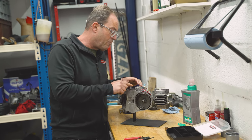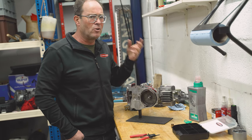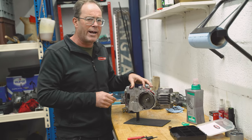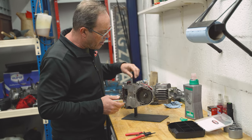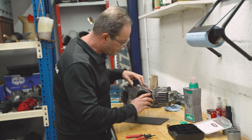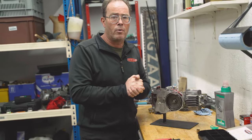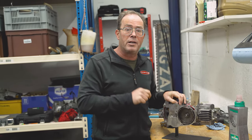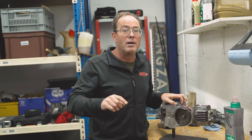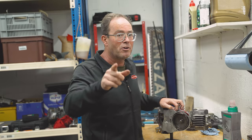We always need to check the internal big sprocket and the little sprocket on the clutch bell. If they are damaged, it won't cause engine damage, but it will make a very high-pitched whining noise — and that's not what you want after rebuilding your engine. If they are damaged, you need to replace the bell and the big sprocket. That's it guys — it's perfect. If you have comments, write them below or email info@pushup.de, and please subscribe and hit the bell for new videos. Thank you very much, bye bye!